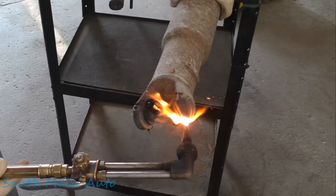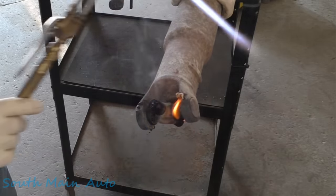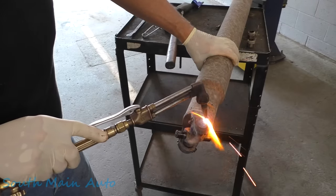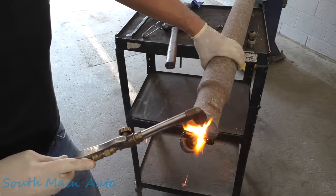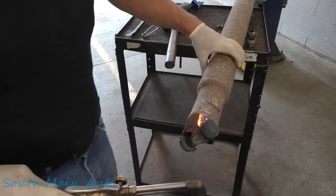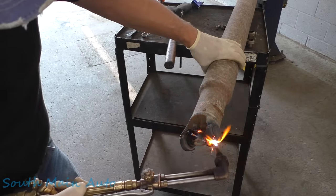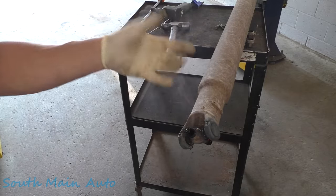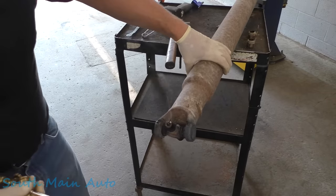This is how we've done it for a lot of years. You can see the plastic oozing up out of there right now. She just shot me with a little plastic worm — it didn't hit me in the face, so thank goodness. I had my safety glasses on. You do have to watch for that because she'll get you. They build that pressure and smoke it. Now you can drive the U-joint out as you would any other, or use an arbor press.